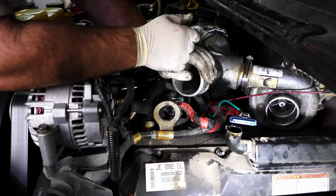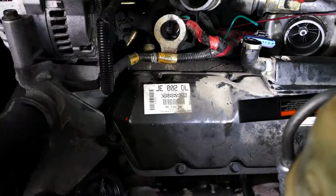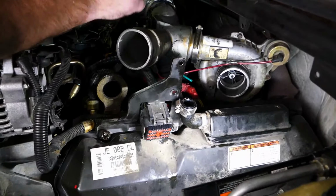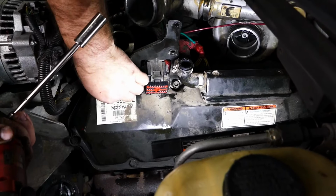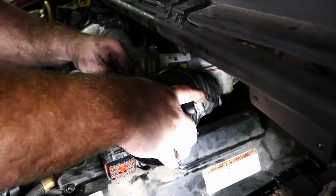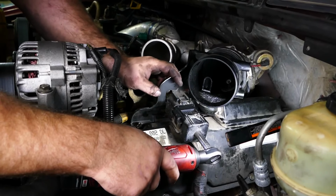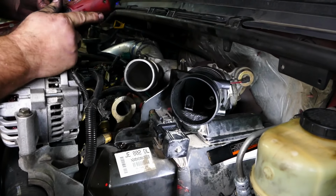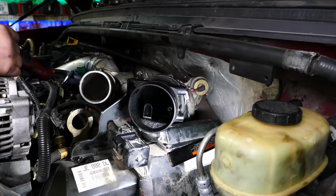Back with the valve cover now. Back together with our 42-way. We'll just snug those things. We won't go very tight. About like that. Now is an excellent time to put back on our intercooler, our charge air cooler piping, where we can get to it pretty easy.